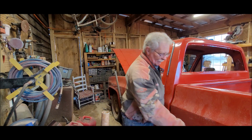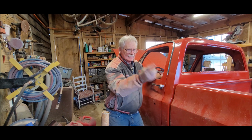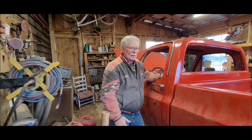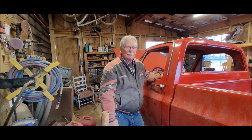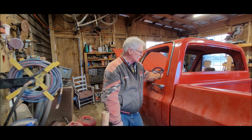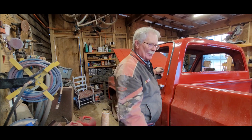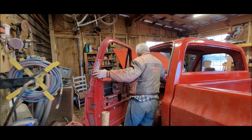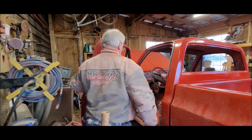There was a breather hose on the inlet there to let it breathe, I guess. I got that on. I'd forgotten to put it on, I guess, when I put the tank up that night. I was in pretty much of a rush, but I got that on. When I crawled down there, I knew what I had done because I could smell gas. I tried to start it earlier and it wouldn't start. Come to find out, it was just out of gas. I hadn't put a lot in it, but now there it goes.